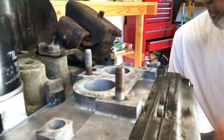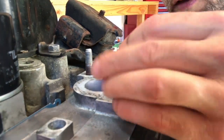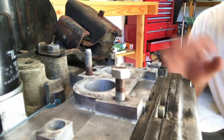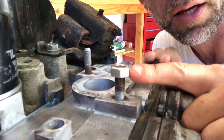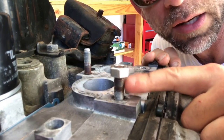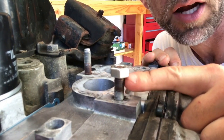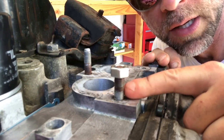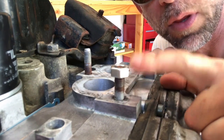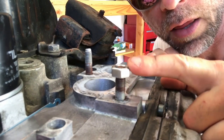Here's the stud we're gonna remove. Put the first nut down — if you have messed-up threads it might be difficult, so you'll probably need a socket and ratchet to thread the nut down. I actually cleaned the threads here a little bit with a wire brush. If you need to use some WD-40 or any penetrating compound to break up the rust a little bit, go ahead. It doesn't matter if there's lubricant on the threads because the nut is going to bind with the other nut. You do need to get the nut down far enough so you can get the second nut threaded on top. I'm going to use a ratcheting box-end wrench.